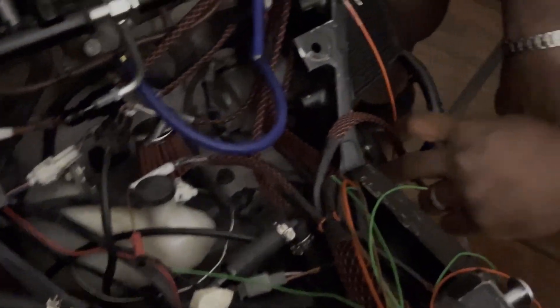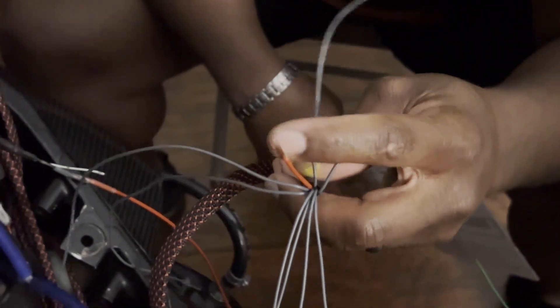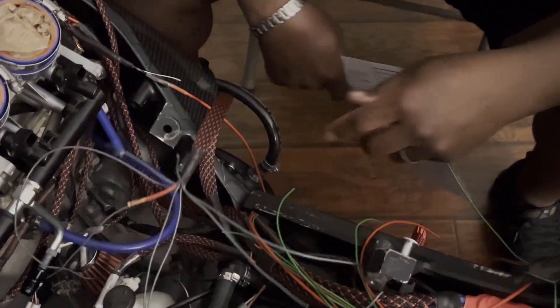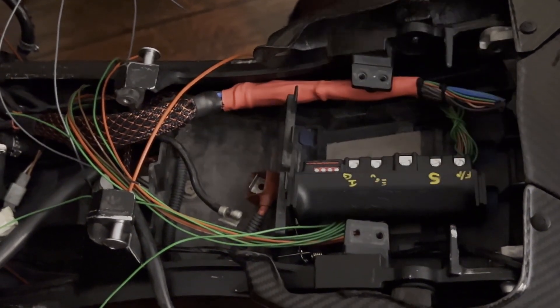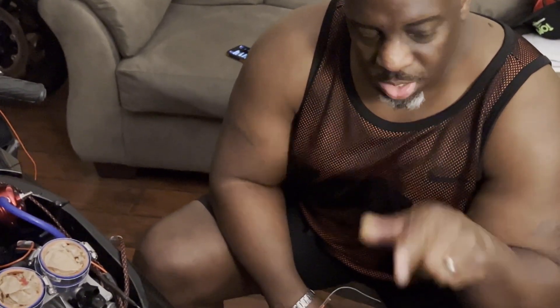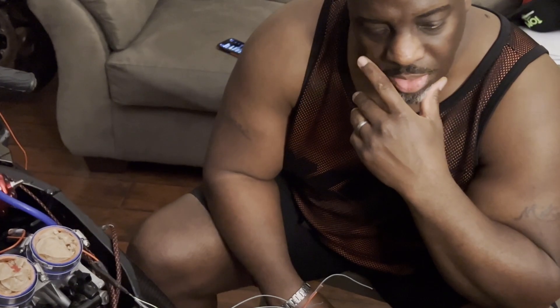I'm about to put the fuel injectors. These are all of my inputs for the fuel injector, and what you have is a common hot line. Once I wire up these injectors, I'll go to the back of the bike. I have to make certain things talk to the relay — I have a solid state relay block. It makes it where you don't have to have a bunch of fuse boxes and separate relays. It has a protective feature where it'll shut off a circuit, and you can disconnect the circuit and turn it back on. Between that and the ECU's ability to self-diagnose, if anything's goofy, I should be able to figure out what's what.